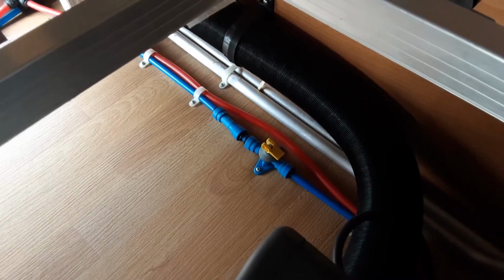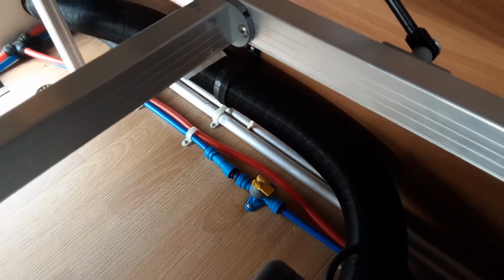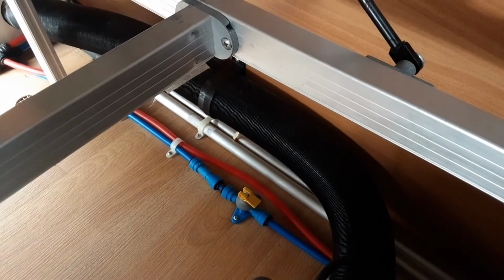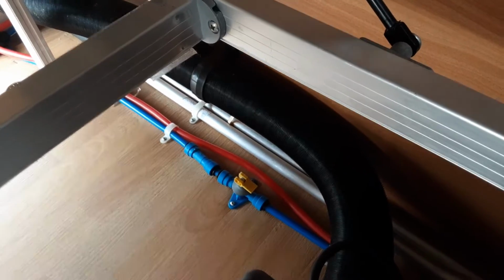To fill the water system though, first of all, you're going to come underneath the bed at the rear of the van. And down the side of the water tank, you'll notice there's a yellow valve just there. The yellow valve is what you'll leave parallel with the floor to fill the water system up. And if you want to drain the water system down, you'll put the valve upright so it's pointing towards the bottom of the seat. So like I said, to fill the water system, parallel with the floor.